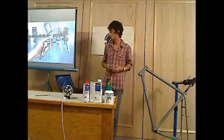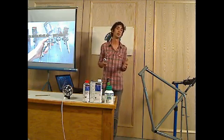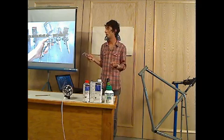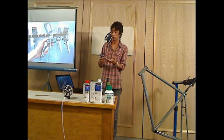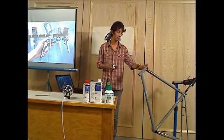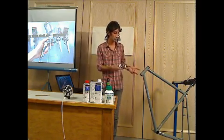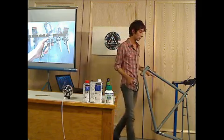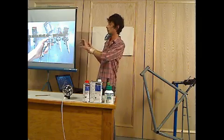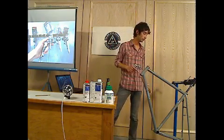I mean, that's kind of where this stuff comes from. So everything we do is, so it's kind of a struggle at times to adapt that to a new medium. So bicycles is a totally different thing. I mean, just obviously a lot more smaller diameter tubing. We're not talking about big flat surfaces anymore, so there's a lot of overspray you can get going on the bike. But normally you want the fan to be very, very low, obviously, so you want to minimize that overspray, otherwise you're just wasting a lot of paint.